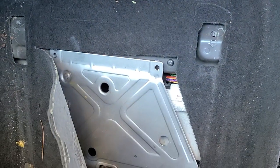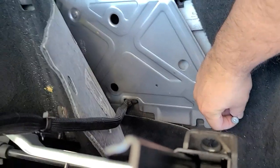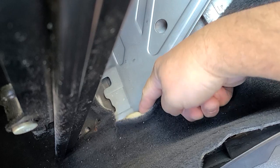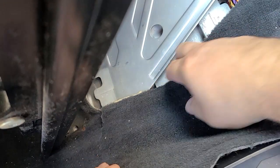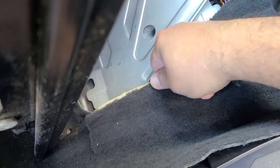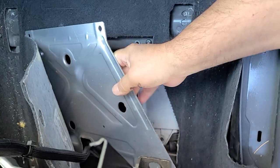The metal plate has four T30 Torx screws. Get these four bolts out — note that one of them is all the way in the corner underneath the carpet. To remove that bolt, you have to lift the carpet completely. This one was already torn, so just lift it up and you can see the last hole in the corner. Then remove the metal shield.